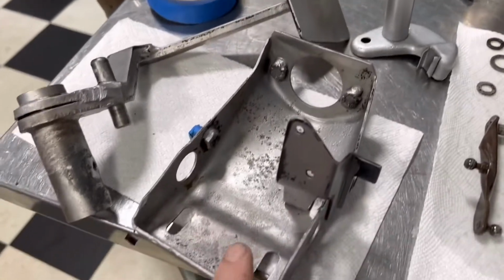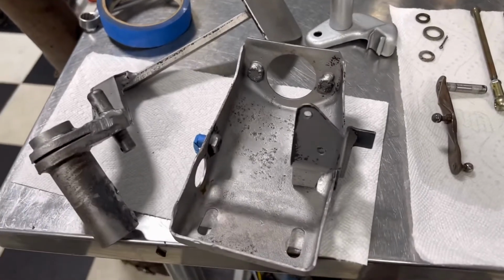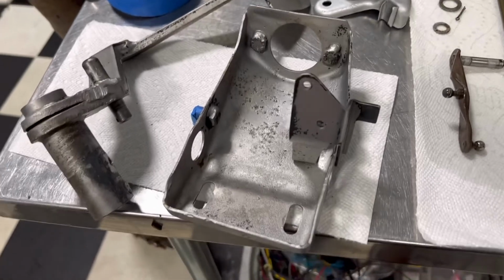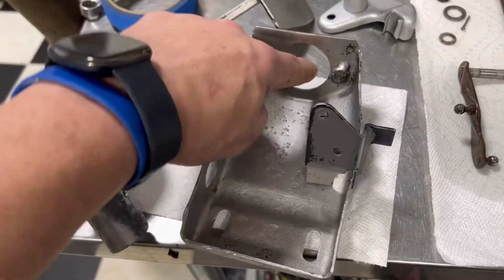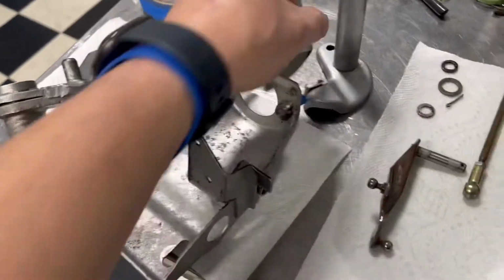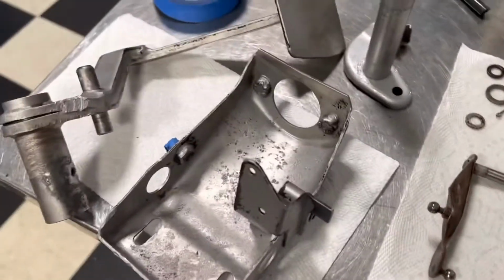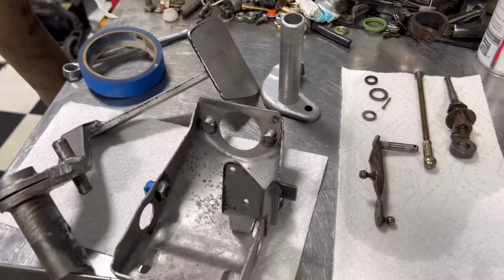Now we're just going to hit these with a ceramic caliper paint, because I found powder coat in the past is too thick and doesn't work very well. Plus it's not reacting well with brake fluid, and that's what we're worried about coming through here. And this piece that sits in here, I cleaned up really well, and then put a very thin coat of silver ceramic caliper paint on it, mainly just for protection. Nothing too fancy there. So we're going to go get these painted up.